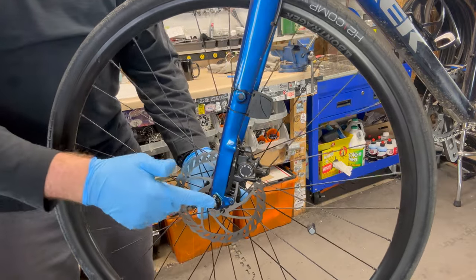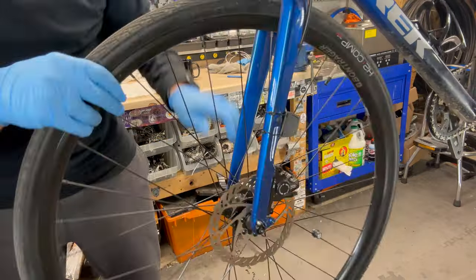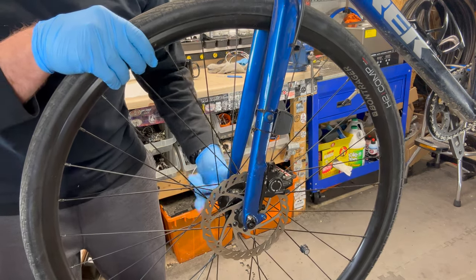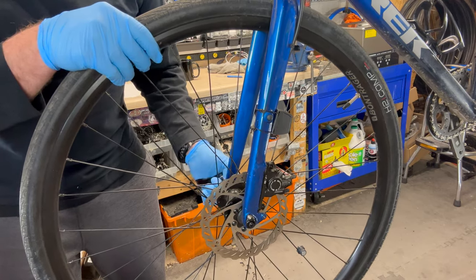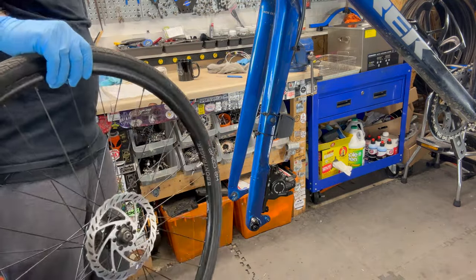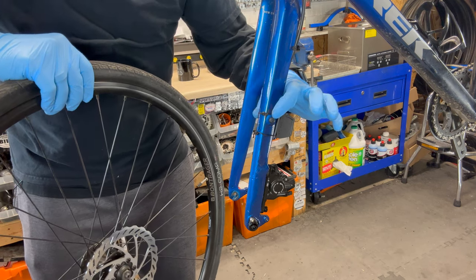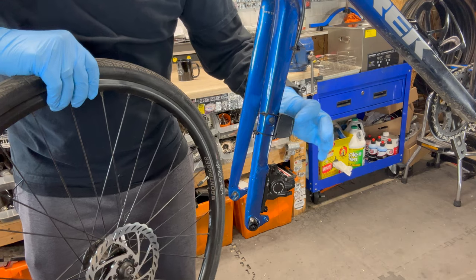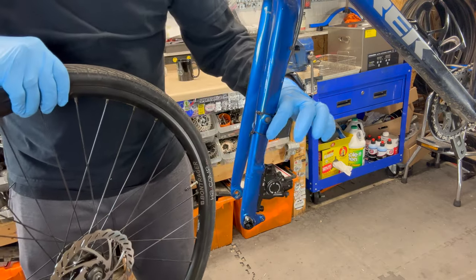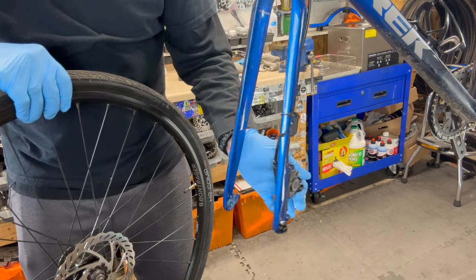So here we have the front wheel. This has an interesting skewer — it's a thru axle skewer combination. These are really interesting. You have to unscrew the skewer all the way and it has a dropout on one side and a thru axle portion on the other, with only one spring — so we've got to keep track of this guy. The owner put on his own computer using twist ties rather than zip ties, which doesn't really hold in place, and he went over the actual cable itself. I'll clean this up, put some zip ties on, and get underneath the hydraulic line — just a little cleaner aesthetically.